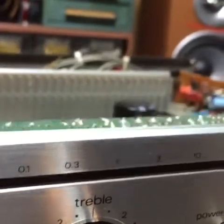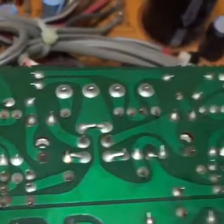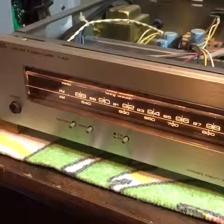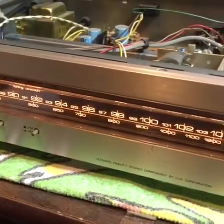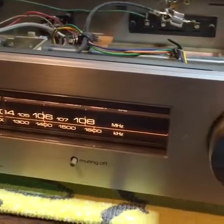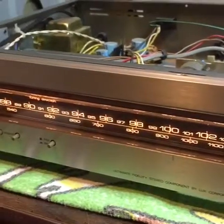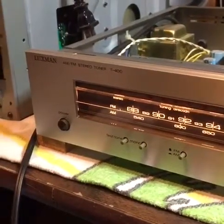Push too hard and you'll likely break the LED housing, or crack the solder joints for the LED lights across the back — so that's a cautionary note when cleaning your L450. A side note for the tuner: if you remove the faceplate to clean it, the dial you see is actual glass, held in simply by two rubber grommets. You have to very carefully manipulate those to get it out, because if that glass breaks, you likely won't find a replacement anywhere.